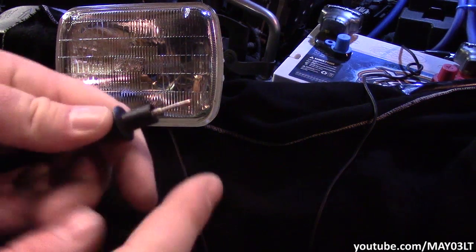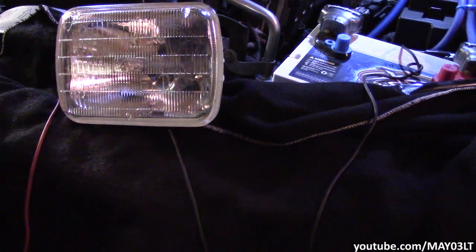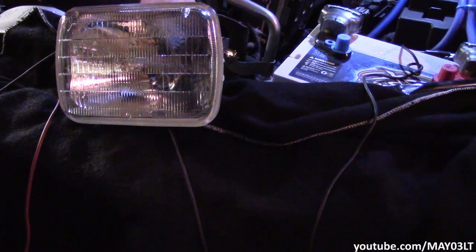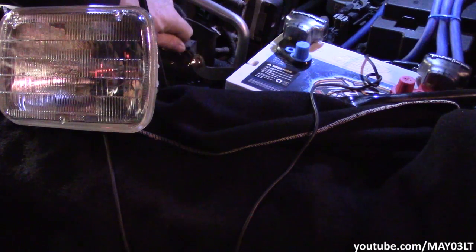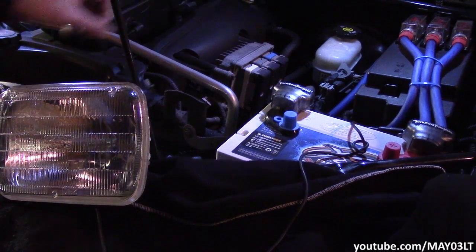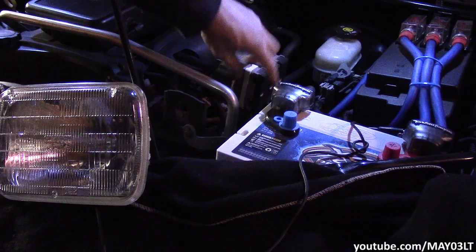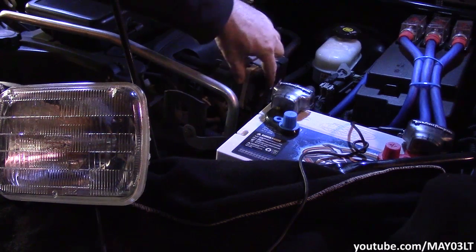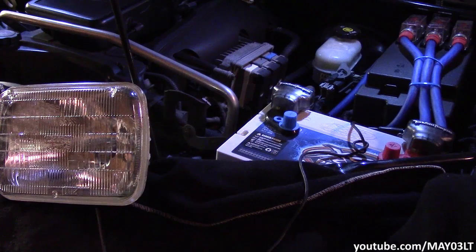If we touch a good ground with this probe, the ground is going to go through this jumper, through the headlight filament, and back to the positive of the battery. I'm touching this bracket bolt right here. Say my PCM in my Trailblazer had a problem where it wouldn't communicate, and I found the corresponding ground pins — I would just pop the connector off and do this test, basically testing the grounds through the wiring to wherever they may be. There could be one little strand of copper making that ground connection, and it would look okay if you were using a DMM. For checking grounds, I go for the super test light.